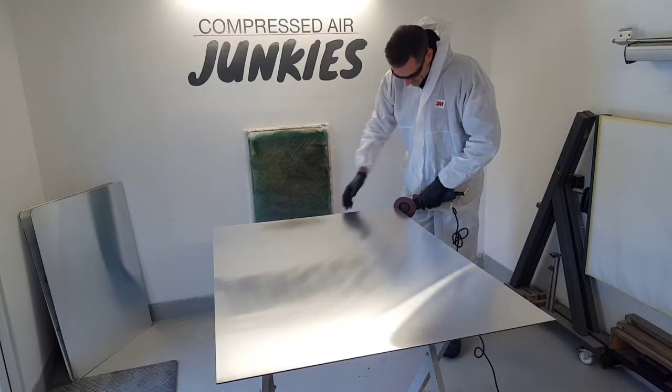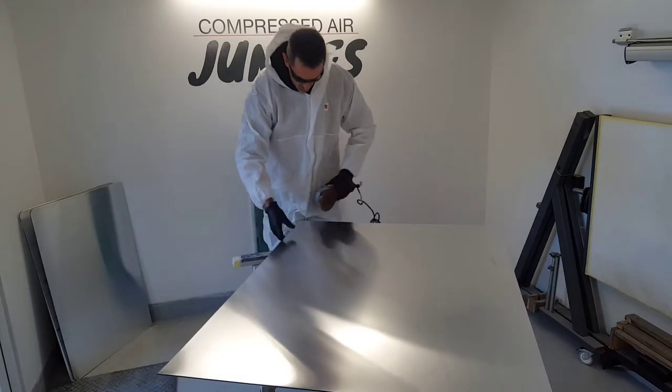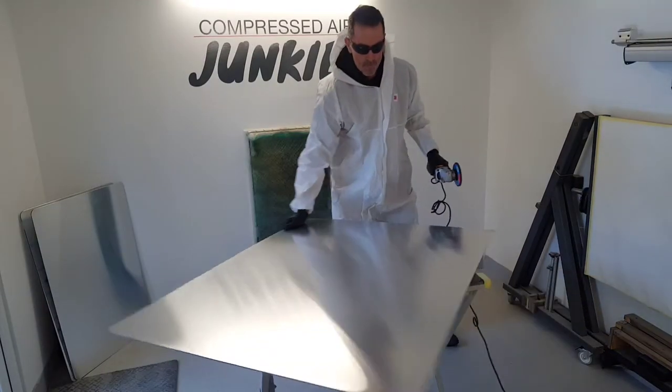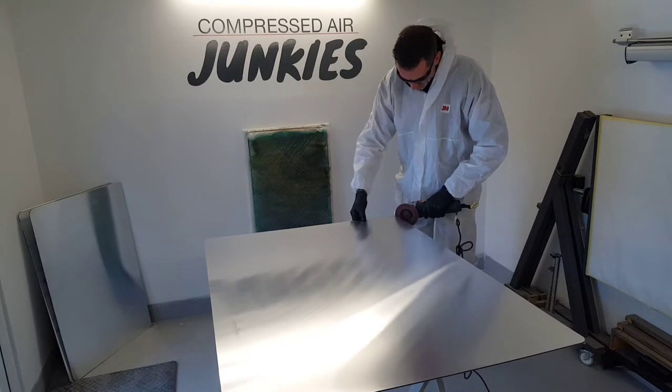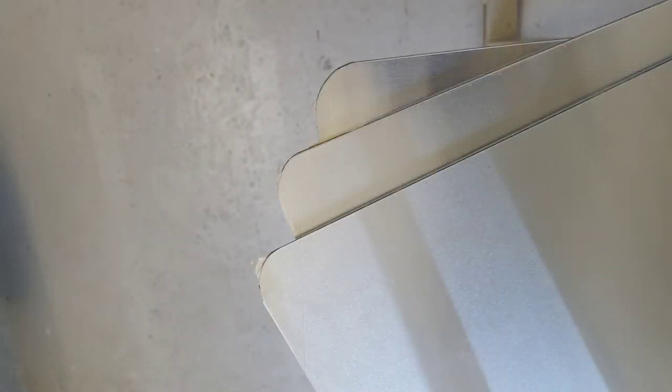The first stage is to round these corners off on all these aluminium panels. As you can see in the far corner there's two that are completed. I'm just going round now with a four inch disc grinder and sanding off these corners and making them smooth. There you go guys, there's the corners complete — I've just radiused them all off so they're all identical.